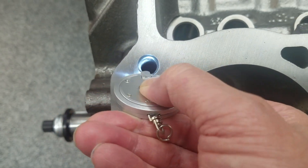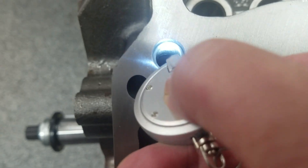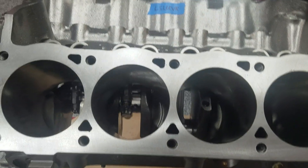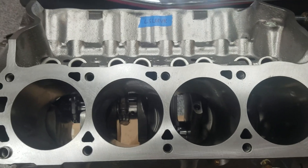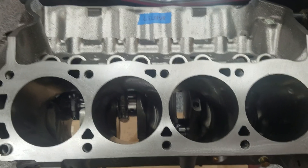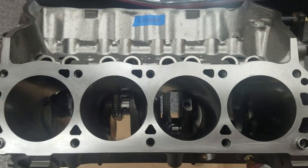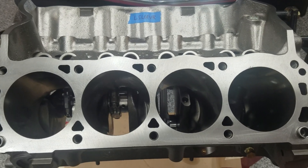None go into the water jacket. This is the late model roller block. If somebody thinks the early model Windsors have bolt holes that go into the water jacket, leave a comment and cite a source — the blogosphere is not a source. Either documentation or empirical shop-level evidence is fine. Anyway, I'll keep you guys apprised on some of the build-up of this 393 stroker. Have a good day.